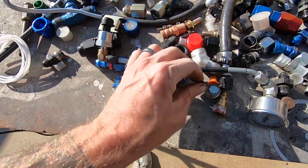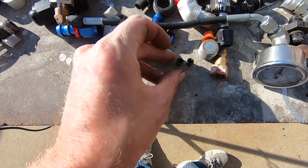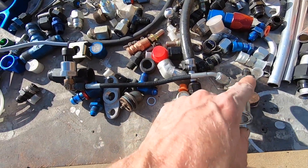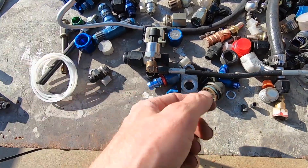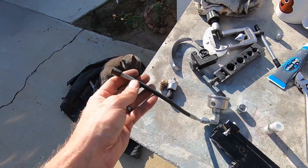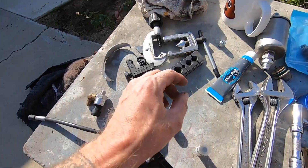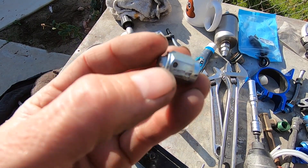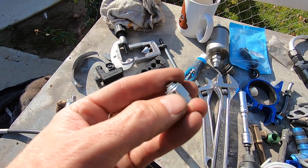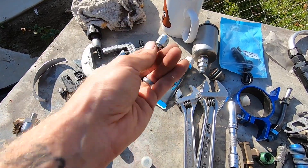I've got collars for both ends, a little 90-degree fitting, and this goes into my pressure sensor — just trying to get the exhaust pressure monitored and routed over. But this hose is too short and it would all melt. I had an extra hose with an end I could use, but when I cut it off I found there's a pin driven in that captures it so it doesn't slide. It's stuck and I'm not going to waste my whole day trying to drill that out for one fitting — so that's Plan A dead.